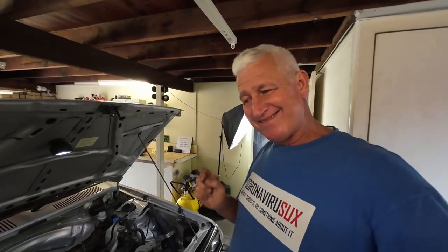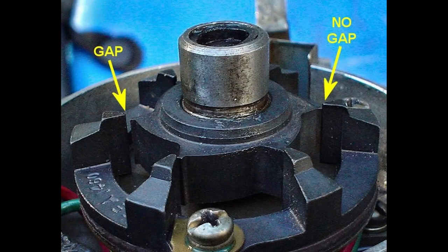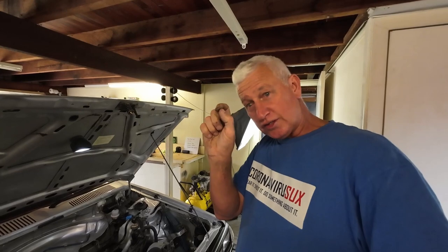I've taken the car out for a couple of runs and it's just not feeling or sounding right. I did put ATF — automatic transmission fluid — in the gearbox slash diff to help with the crunchy gear, but I don't think that's going to work. I reckon it could cause more problems. There's a bit of noise from the box or the diff so I'm going to change it back to good quality proper gearbox and diff oil. It also feels a bit flat in a few spots, idles high, and it sounds like it's pinging. Before I can adjust the timing, I've got to check a few things. This doesn't run points — it runs what's called an air gap. I need to put a feeler gauge in there and make an adjustment.